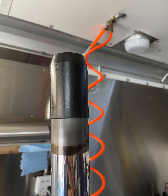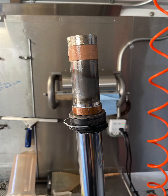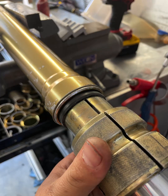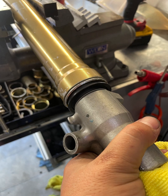This is a Laner Suspension seal bullet — it protects the seal when you're installing it. You can also use a plastic bag. Install the dust seal, then the oil seal. I like to use grease. Inner and outer slide bushings: press in the outer bushing, press in the oil seal, install the retaining clip. I use half of the seal driver to get the clip in, then press in the dust seal.